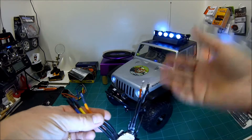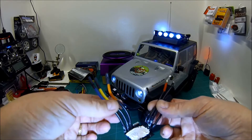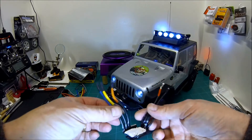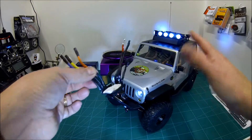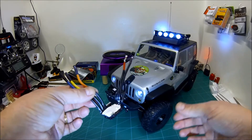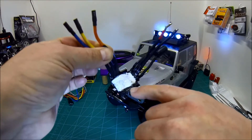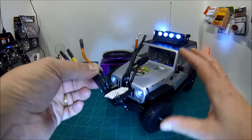On the second day of testing when I finished my successful test, I powered the model on in the evening just to wind in the winch cable after it was drying out, and it was dead. Completely dead. I looked at the ESC and there was a plastic cover over the LED window with some condensation in it.